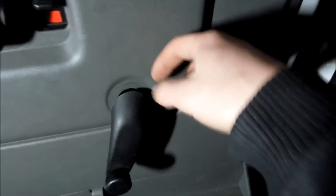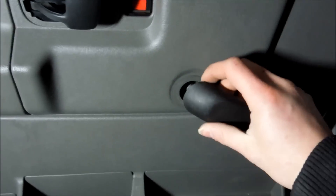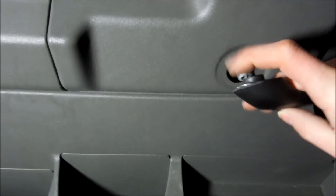Right here is your door handle. The best way to remove this — I have a video on it — is with a door handle removal tool. You're just going to squeeze in behind here and push this clip forwards. You can also do it if it's like this: squeeze the door panel in and try to get a hook pick in there and pop that clip forwards. So after that's out, put that off to the side.